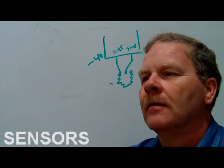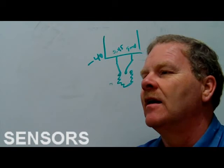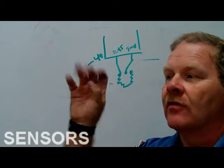Can't you test the fan, hooking the meter up to it and spinning it like you did? Or hook a light up in series. Ground on one side, test light on the other side, hook to power, and if you turn it through, the light winks off.